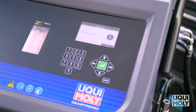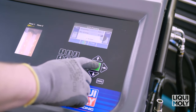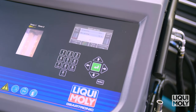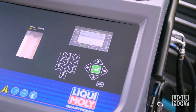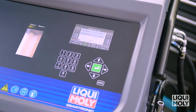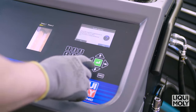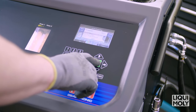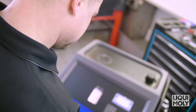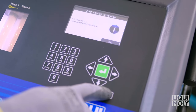After completed cleaning, there is a beep. Then press Enter. Now the transmission rinse process takes place. After completion of the process, you can check the result using the viewing windows. Should this not be sufficient, again rinse an oil quantity defined by you. The oil fill level then follows according to the manufacturer's specifications. Here you go by the temperature indication in the display. If the fill level has to be corrected, select Fill or Drain in the new oil menu. If the oil level is correct, complete the process with Escape.